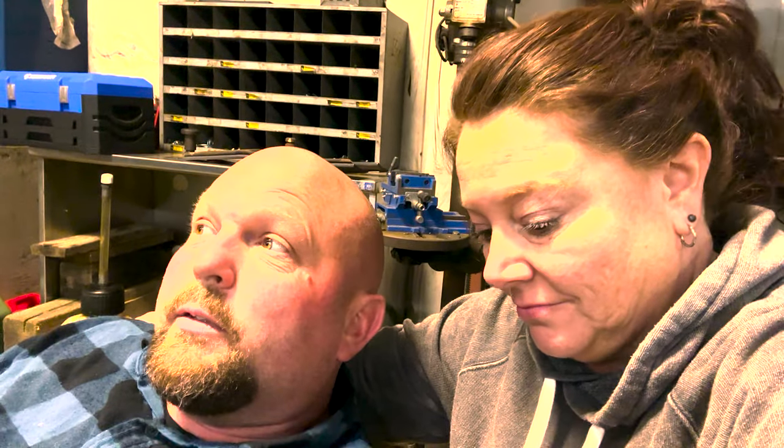I got some of the outside caulked and got the overhead escape hatch. They don't make a Max Air vent for it because it's an escape hatch, even though I looked for one. I found some cracks in it, so I covered it with Flex Seal. It comes in a bucket like paint, so it's a little thicker than a spray-on. I painted the whole lid, so hopefully that fixed our leak.